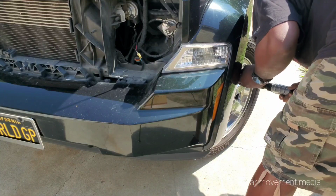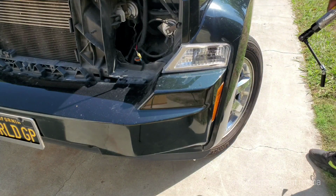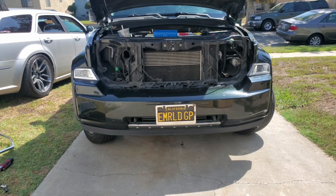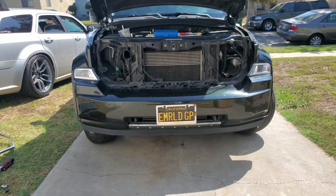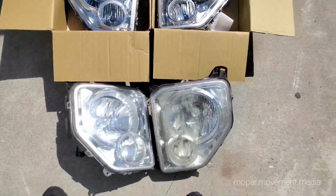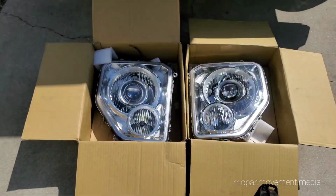Not quite. A little more scrolling. And we're good. Well, turn signals are in, working. We got the rapid flash though, so these are not CAN bus enabled bulbs. We'll take care of that later, but they do flash, they do work. So we'll have the fast blinking for a minute. I remember back in the day, people used to pay to buy the little flashers that would flash fast because they wanted it that way. But either way, it's good. LEDs, always better than incandescent. So we'll leave it like that. Now, time for headlights. Out with the old, in with the new.